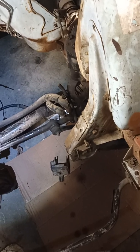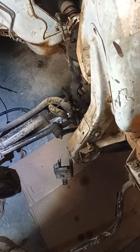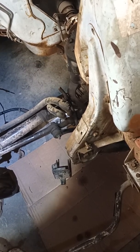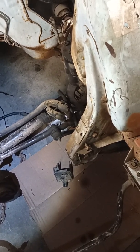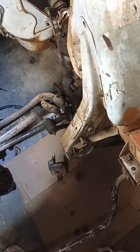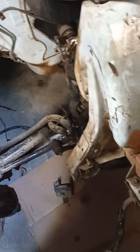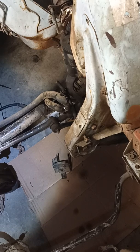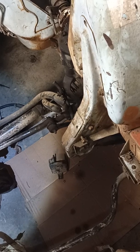This is going to have four-wheel disc brakes. I haven't decided if I'm going to use the standard Mustang rotors and calipers or just the Explorer rear disc, but either way it would stop really excellent with disc brakes all around. It's so light you'd probably have problems with it stopping so quick — you could easily lock up the wheels. I'm going to have pretty meaty tires, 17s or 18s in the front.